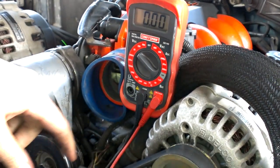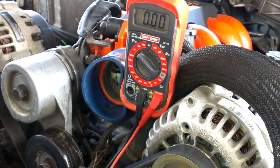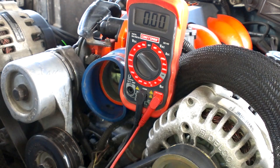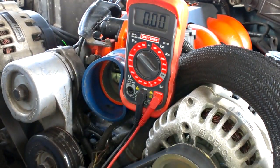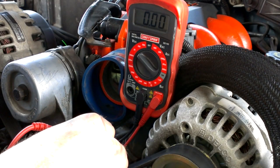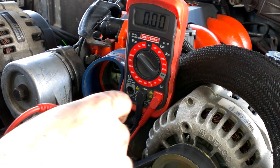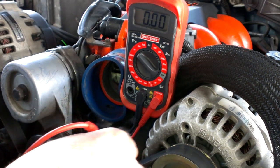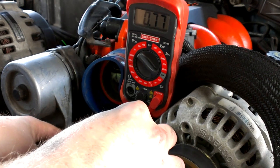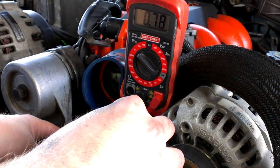This will test the wiring and everything, and the actual EGR valve itself. So what you need to do first is get your multimeter out and set it to DC volts. On letter C, you need to back probe that and have your other lead on ground somewhere — just a good ground. I'm going to put it on my battery. With key on, on letter C, with the EGR valve connected, it needs to read between 0.6 and 0.9 volts. And here you can see it is.